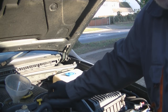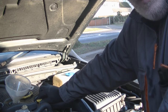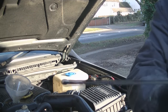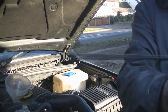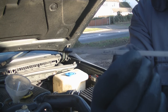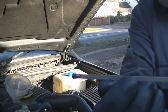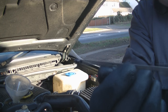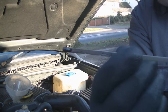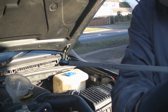Just a top tip — not from a mechanic, but from someone that's had Discovery 1s for about 8 years. When you change the oil and fill it up on the dipstick, don't fill it to the full marker. Try and fill it up to halfway between low and full. I've found that if you fill it all the way to the top, it just burns oil. So that's my two penneth — take it or leave it — but that's where I'll be topping it up to now it's cold, flat, and on the floor.